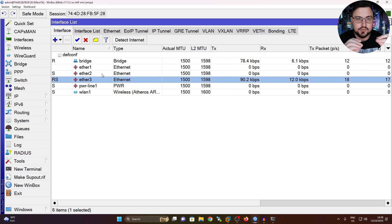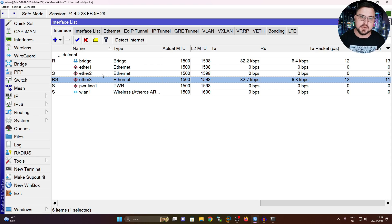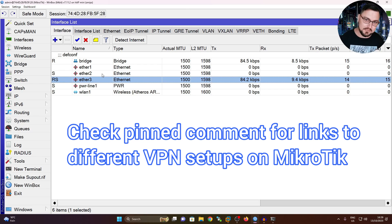Our goal is to connect onto a public SSID on this MikroTik, and then connect via cable on our laptop or machine. Unfortunately this is not going to work for phones - if you want this setup for phones, you'll need a bigger MikroTik, like a HAP AX3 or AX2, something with multiple radios so that one radio stays bridged with your LAN while the other connects to the internet. For my laptop this is great for security, since I can configure a WireGuard VPN or IPSec out over the WLAN interface so wireless people can't see what I'm doing.